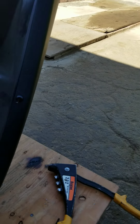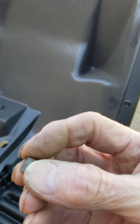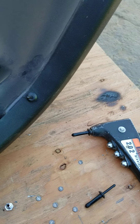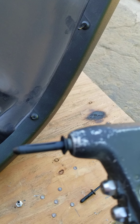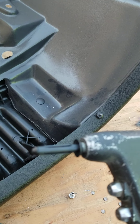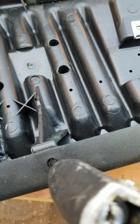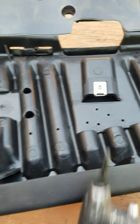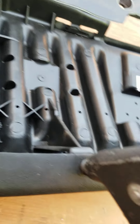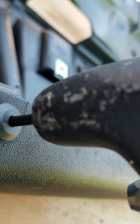Marcy's helping today — hello, baby. Let me show you how the riveting gun works with this little mandrel in there. What we've done is installed the adapter into the riveting tool, and we have one of the poly rivets installed in there. Here's the hole where it goes. Go ahead and get that lined up and get that put in. What we're going to do is just draw that up. When it releases, it's going to leave a little area here, and you have to hold the bottom of the fastener — otherwise it's going to blow at the bottom.